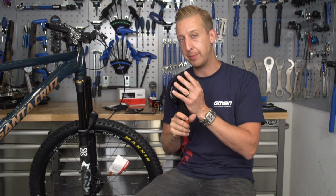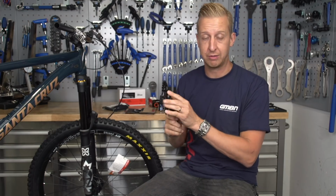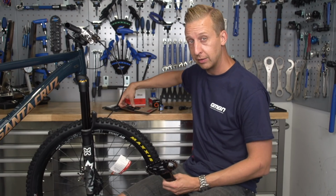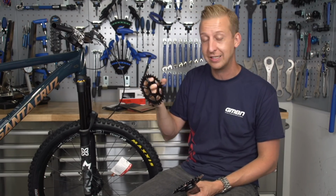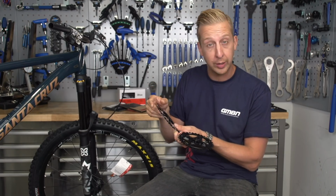I had an issue because the particular chainring combination that came on this DMR Axe crankset is not compatible with this frame, and it's actually too big as well. It's a 34 tooth. Now, Praxis very kindly sent me one of their wave rings, but that was also a 34. I didn't realise until I went to fit it. So, thankfully, Ollie Wilkins and the DMR crew sent me one of the DMR rings. This is called the Blade, and this is in a 32, and this looks banging. This is really nice. Narrow wide profile on there.